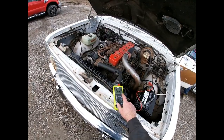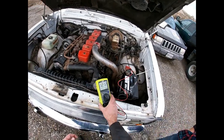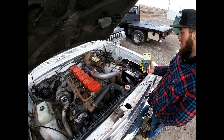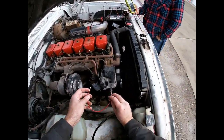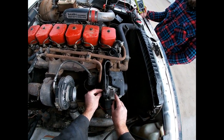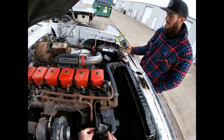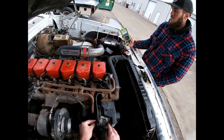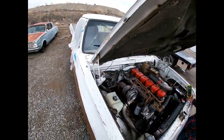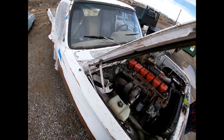You can see we're still only getting 12.10 volts, so the alternator is not charging — you should see at least 14. Now we'll take the upper bolt and touch it to the case, and you can hear the engine change. We're getting 16 volts — that's a lot, it's actually going to overcharge because the voltage regulator is not in the equation. What that's showing us is that the voltage regulator is not telling the alternator to charge.